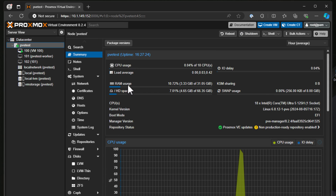Inside Proxmox, we've got 18 times Intel Core Ultra 5 125H CPU shown. Interestingly, Proxmox identifies this correctly at one socket, which matches the single-socket hybrid CPU architecture. However, when I boot ESXi from another NVMe drive, VMware ESXi reports it as two sockets. I'm not sure what causes this difference in CPU socket recognition between Proxmox and VMware ESXi, but this is the first Core Ultra CPU architecture where I've seen this with VMware ESXi.